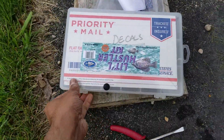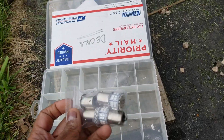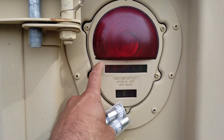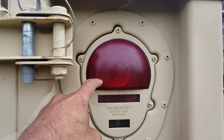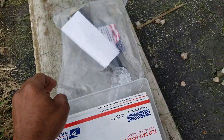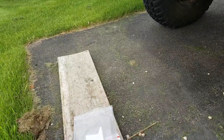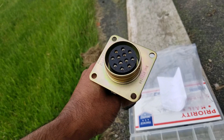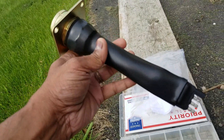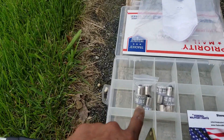Let me quickly show you what I have here. I got this last fall — two sets of LED bulbs, 12-volt LED bulbs that go in here. We need to replace the 24-volt bulbs with these. I got two sets for the two tail lamps. And this is the adapter I was telling you about — it plugs into that adapter I showed you in the front, and the other end has a civilian tailgate wiring adapter, so it should be fairly plug-and-play. We'll get to that in section number two, but step number one — let's get these installed.